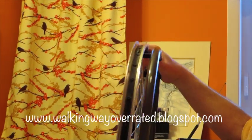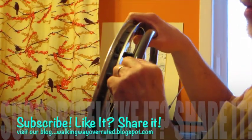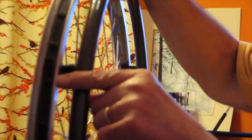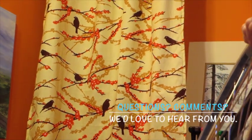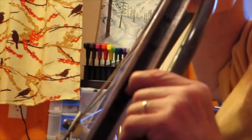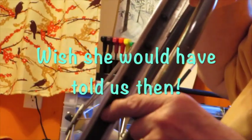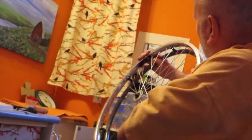Where the rim separator is, is the grab bar. The rim separator is attached to the aluminum rim on the inside. There's a rubber — it looks like rubber tubing — that goes all around to cover all the spoke tips and any screws. And right on each side of it are two very sharp protuberances. Maybe it's the rubber or maybe it's the metal underneath, but they have come to the point where they're poking a hole — they're wearing through to the tire.